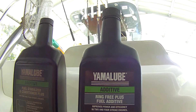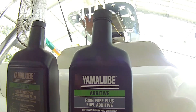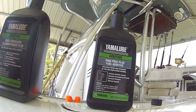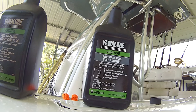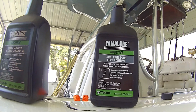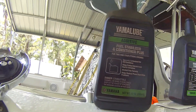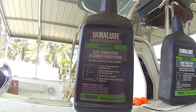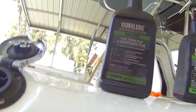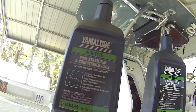Say my last trip was 20 miles out, so round trip is 40. With a loaded boat I burn about 11 or 12 gallons on a 40-mile round trip. Before the last trip I added the fuel stabilizer and conditioner - about four to six ounces of that.